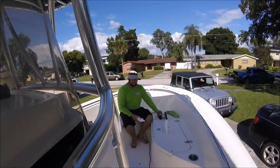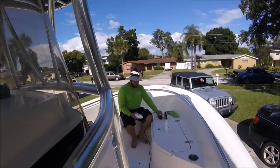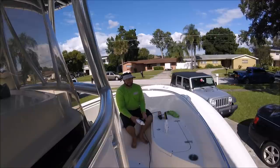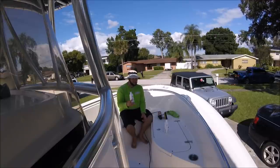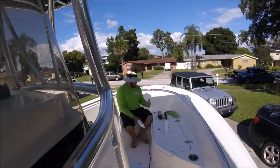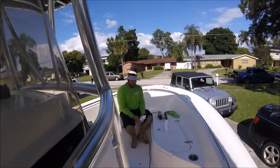It's easier to use than a rotary, not necessarily a problem until you get inside with all the nooks and crannies. The Gel Coat Oxidation Eater compounding polish is far more aggressive than Infinite Cut, and you don't need that much cut when you're not dealing with severe oxidation. This is only lightly oxidized.